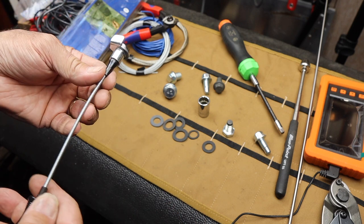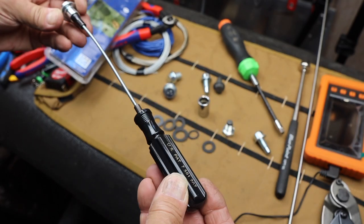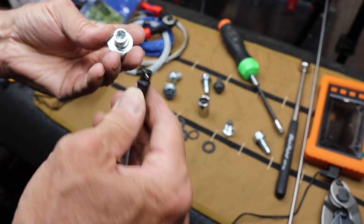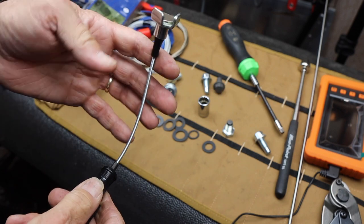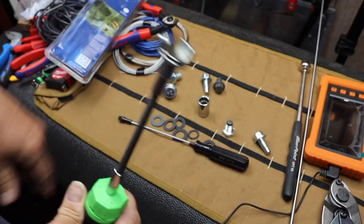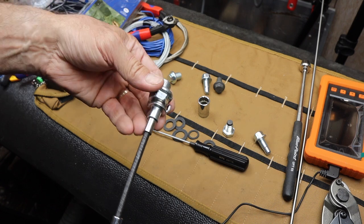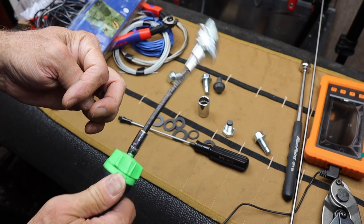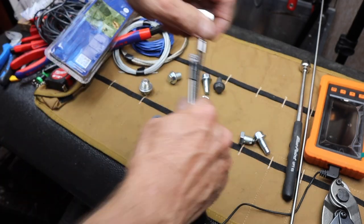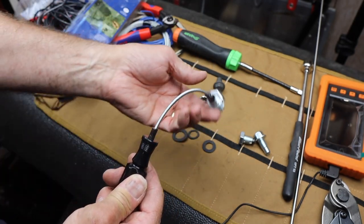I started looking around and found a couple others on Amazon. Marginal, normal reviews — a couple people said some of them were coming loose, the magnet falling off. This looked like the most serious, reputable one. Definitely a patented one. A couple of them came apart like this, so it has a quarter inch drive with just this adapter — I wish you could just get that. But when I used it, I realized that maybe this floppiness is actually a good thing. Because if you put it on — the snap-on head here is pretty stout — as you're undoing the drain plug it grips really strong, but as soon as it pops out it might flip or come loose or spray oil. Versus this soft, flexible version: as soon as it comes out, it just falls right down into your pan and stays there.